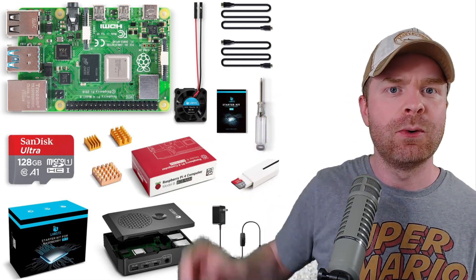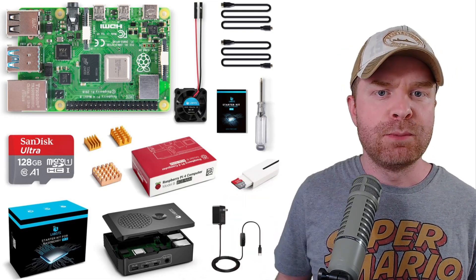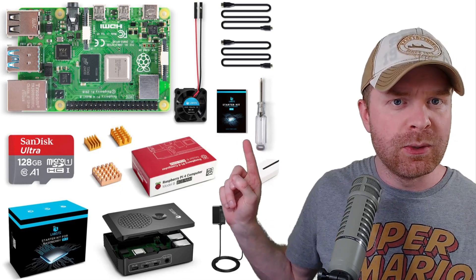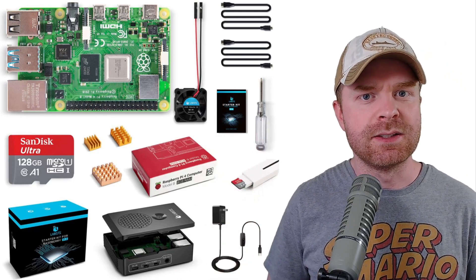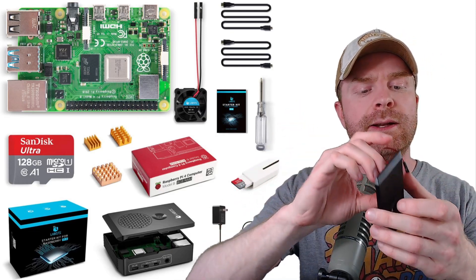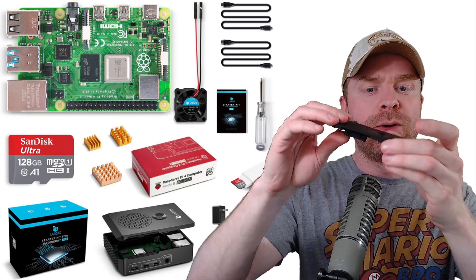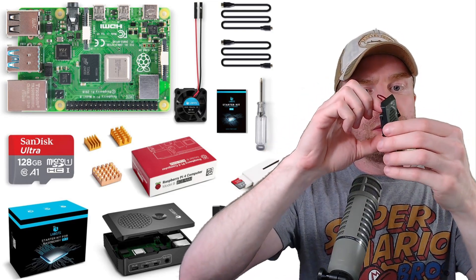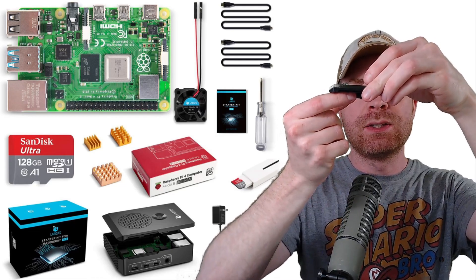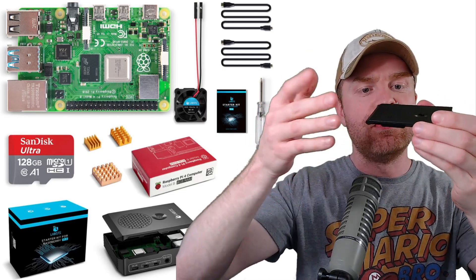I also like that this kit comes with two micro HDMI cables. The only thing you're really missing from this kit is a keyboard, a mouse, and a monitor. Both HDMI cables and the power supply cables were thick and they felt like they were good quality. I also like the fact that they went with a name brand micro SD card with SanDisk. There were two things I did not like about this kit, and both of them have to do with the fan. The first thing I didn't like is that if you have the fan tightened very tightly against the top lid, the lid will vibrate and make additional noise. What I had to do was loosen the screws just a little bit so the fan can hang down and rest on the screws as opposed to being pushed up tight against the lid. This helped reduce the vibration and overall noise.